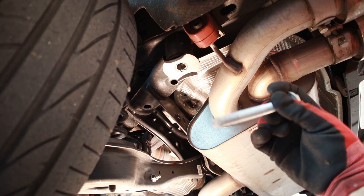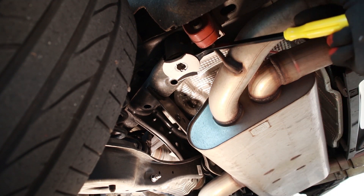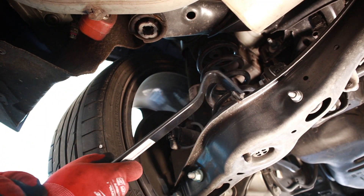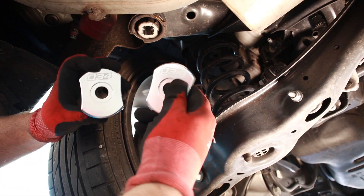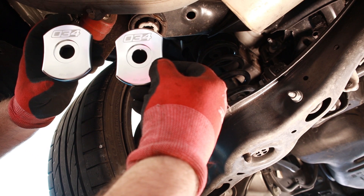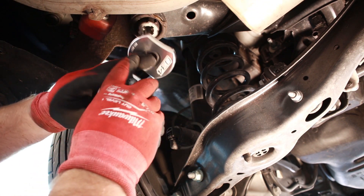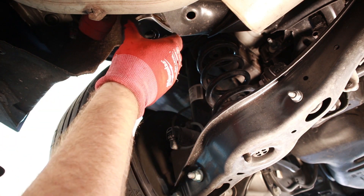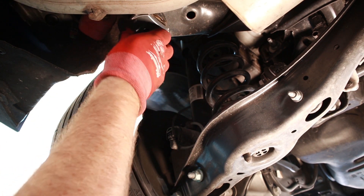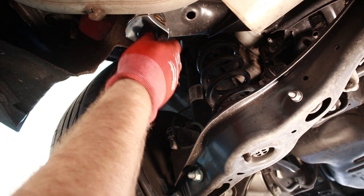These are good long bolts. So this is what we're replacing — you're going to need some kind of prying tool. Here are the two units. They look exactly identical from the front except one is denominated 0030 and the other 0031. The 034 logo needs to face the front of the vehicle — when it gets inserted they all four will do so. The shallower ones — the 0031 — go in the rear. I'll insert new Loctite and we'll get to reinstalling.